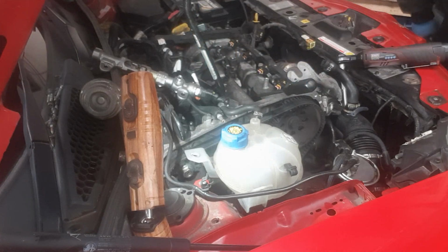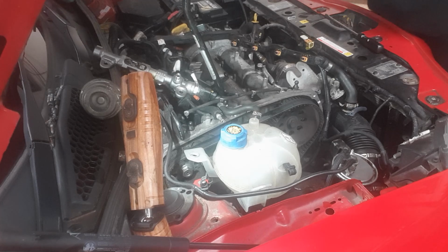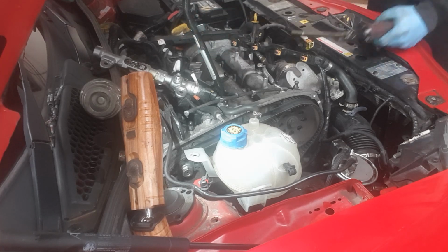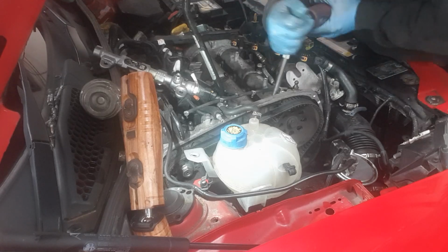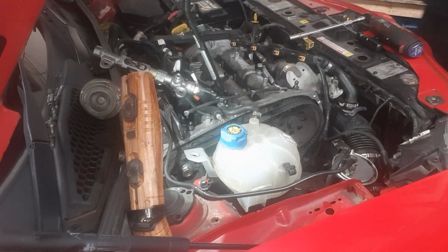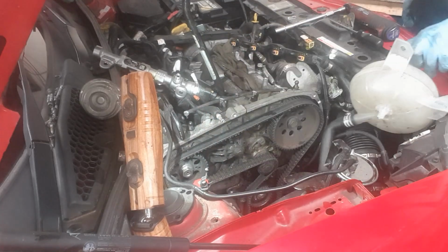Now let's just jump to the other two being removed, so I haven't got to do as much editing. Okay, that is now all four injectors out. The last two come out pretty easily, actually. What I'm going to do now is remove these five or six centre bolts and then put some rag down the hole so nothing drops into the cylinders. And now the rag's in there, we just need to remove the cam belt now, and then we can start removing the head.